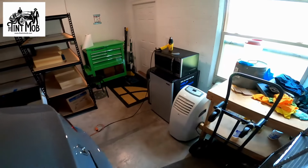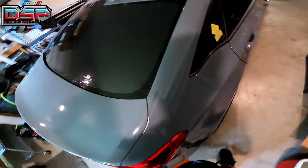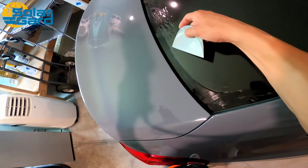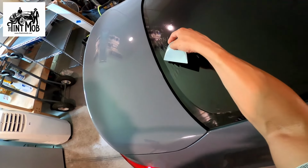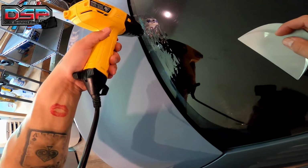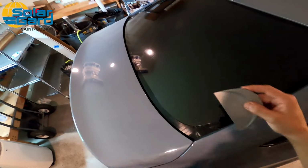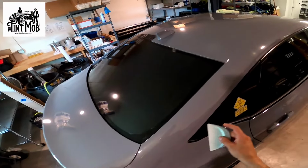Heat again. All right, GoPro died, sorry. All right, so double snapping again, let's pick it back up. We're on the double snap now, wait until the fingers lay down, till that edge lays down. You'll see the line, and if you don't see the line from a pre-cut, if you're gonna hand cut this, then you'll just see that edge just tighten up, boom. Just like that, and hard card. And again, what that's gonna do is save you from having to chase fingers down there because it's gonna be just a little bit tighter.